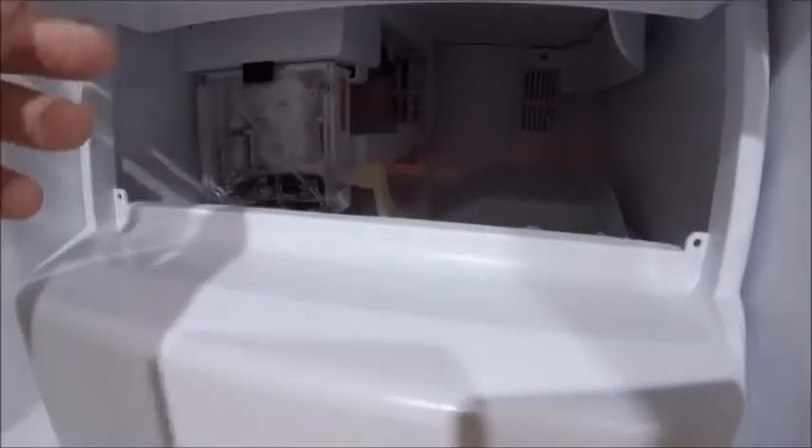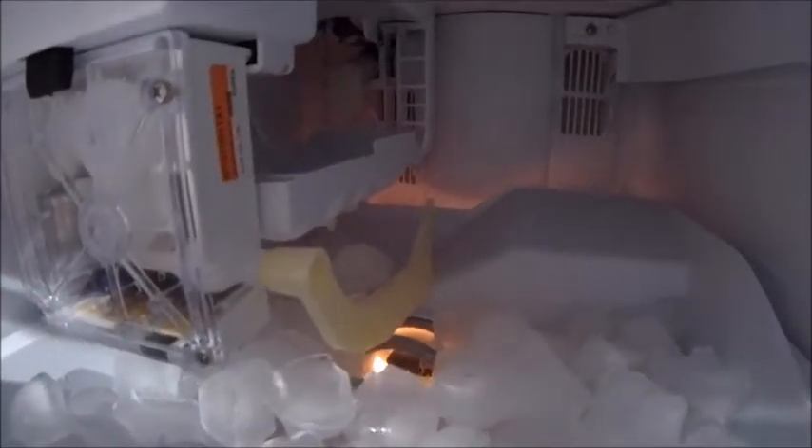There's the ice coming in, and now in theory when the ice gets to a certain position that lever should pop up — it's actually above the height it needs to be at the moment. So that then goes to about there, clicks off, and it stops producing ice. I'm going to shut the door and we'll know in a few hours whether it works or not. In theory it should fill up because the sensor on the bottom isn't sensing ice, so it's not at temperature to dump it all in the tray.